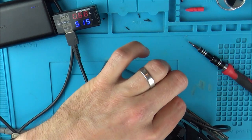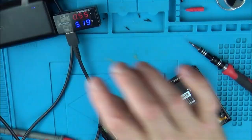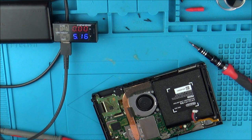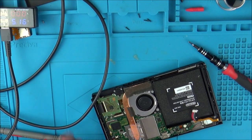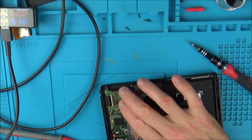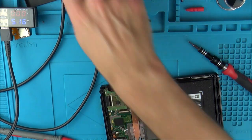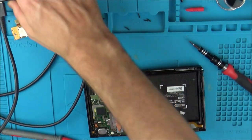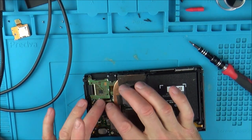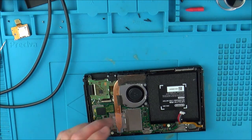Whoa — what's that? Let me unplug it. Wow, that's some serious noise — a lot of squealing. That didn't sound good at all. Okay, we know the switch is turning on. I think the problem is the ribbon cable connector up here. Let's undo a bit of this — remove the heat pipe and the card reader. That was one hell of a scream. Unless having it on there was shorting against something. The switch was definitely on but there's nothing on the display. Worst case: battery replacement and it works as a dock switch.